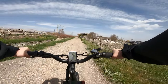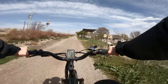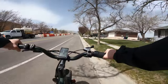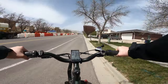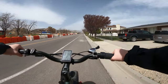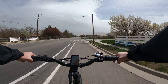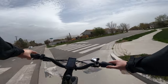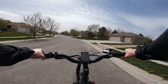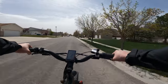Running the bike in mode 3, which is the middle riding mode, gives you good speed of around 20 miles an hour and will help stretch the range out to 20 miles or potentially past that. Riding in the lowest two speed modes will give you a decent workout but will extend the range much past the 20-mile mark. The 48V battery means that you get a bit of fall-off in performance for the last third or quarter of a battery charge — I lost a couple miles an hour of speed in each riding mode for the last few miles of range each time I drained the battery.